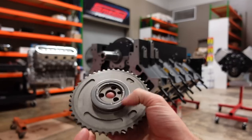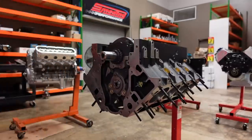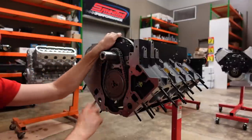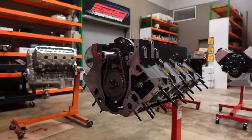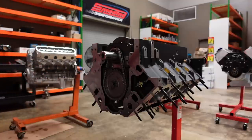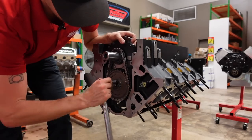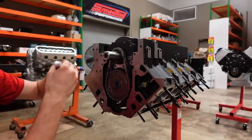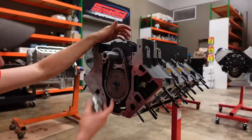To help support the camshaft timing set, we have a thrust bearing that goes on the back of the gear to ride up against the thrust plate of the engine. We're going to run this camshaft straight up because it already has a few degrees of advance built into it. I personally like to run a little bit of Loctite on the camshaft bolts as well — doesn't hurt, can only help. Do a little paint mark so we know everything is torqued. Then grab the camshaft and do a little wiggle check — you should feel a little bit of play in it.